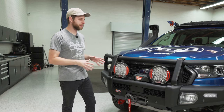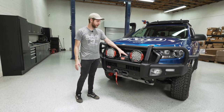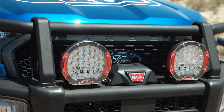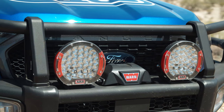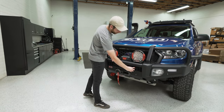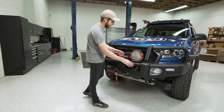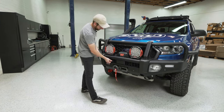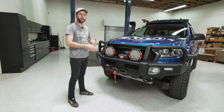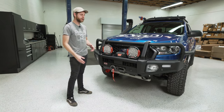Outside of the safety tech, the bumper integrates well with accessories. The Warn winch is tucked in nicely, and the powder-coated aluminum plate across the top matches the rest of the bumper. Even though it hides the winch you still have good accessibility — there are clever little plastic hatches so you can get to the winch clutch lever, plug in your remote from the top, and access the motor on the other side. They definitely thought it through.